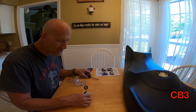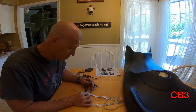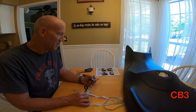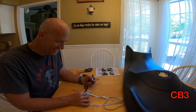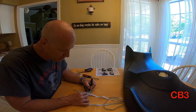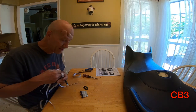We have to measure three-eighths of an inch from that peak. If you don't know how to read a tape measure: that line right there is an inch mark, those halfway are the half-inch mark, that's a quarter-inch mark. A quarter inch would be two-eighths, right? So every two of these lines is an eighth. One-eighth, two-eighths which would be a quarter, three-eighths would be there. Four-eighths, which would be a half. There's your Coach Bob math lesson for the day — and there is our three-eighths inch line right there.